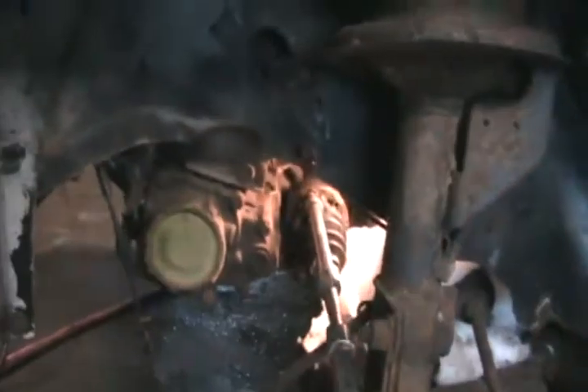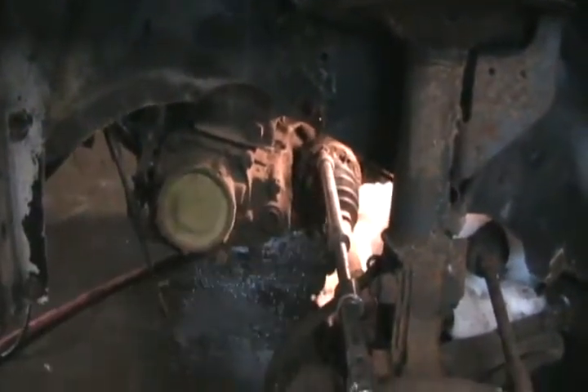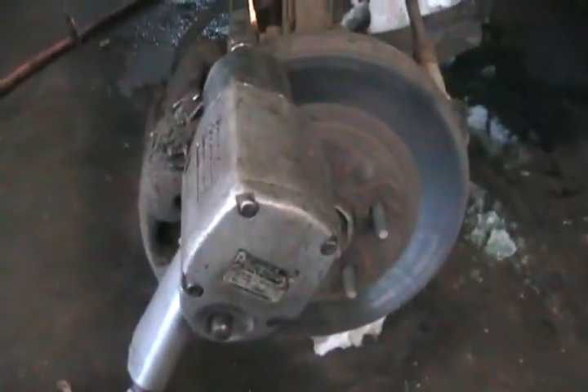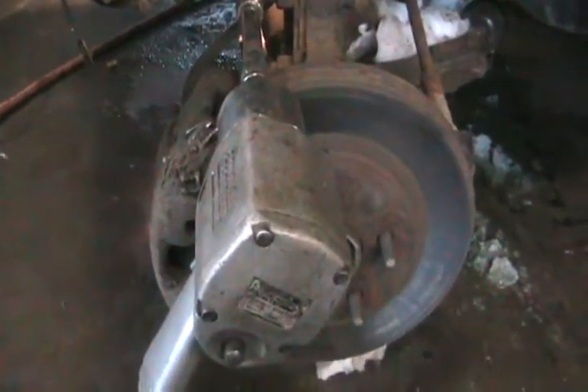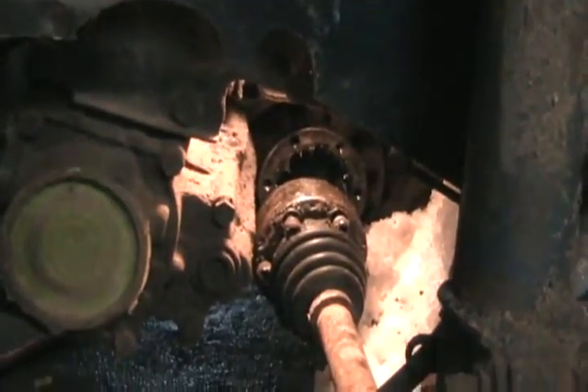There's one out. I just rotate the rotor a sixth of a turn, bring the next bolt to the top, undo that, and keep repeating that step until I'm all done. Then off to the other side. The axle's separated — now to do the other side.